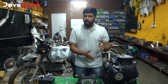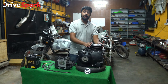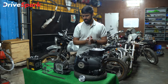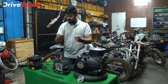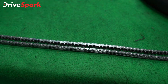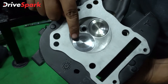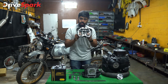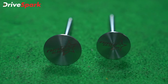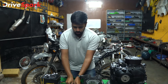We're almost there — the bottom of the engine is already done and we've got the bore on it already. This is what this build is about: a 499cc bore. The piston is also in there at top dead center right now. Let me show you each of the parts on the table before we put the engine together. This is a cam timing chain. This is the head — it's already been ported with big valves, the NMW Racing valves. This is the head cover with the rocker arms, and you've got the gaskets here as well.